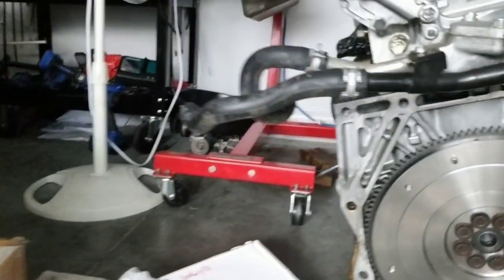Caught everything because it cut out, but essentially I number them that way, so when they did move, it was easier for me to see. I did torque them down to 87 foot pounds of torque, the way the TM or the page calls for, OEM standards.